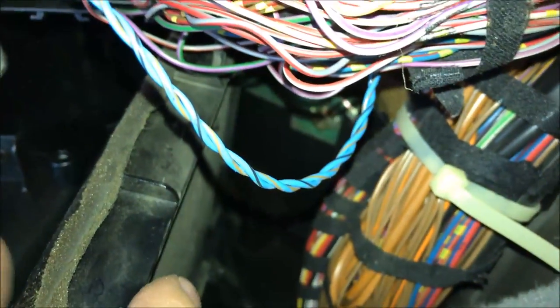The next thing you have to pull off is this electrical housing. You have to take a screwdriver and push it up between the side right here, and you can see once you do that, you see how these clips are connected. Once you do that, you're able to take out the cabin filter. Now, when I first did it, I did not take off the electrical housing, and you'll see that as I pull it out, it hits and I basically just rip it all apart. But obviously, you don't want to do this with your new filter. Lessons learned — when you do it, make sure you take off the air duct housing and also that little electrical unit, and you'll save yourself some headaches.